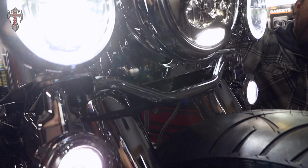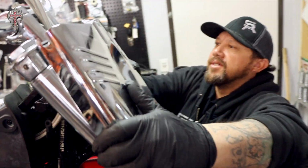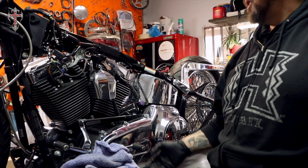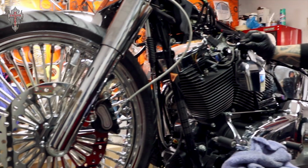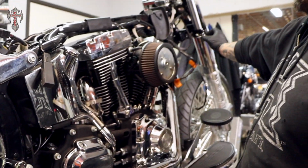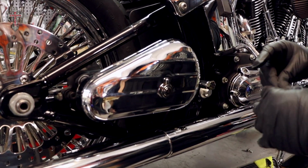Halos on the spotlights. Yeah, so it was a Fat Boy, so it's going back full air ride, front and rear, with the fast up. The rear is Legends, which is all self-contained, and the front is from Scully's Customs. 20 seconds and you ride it. And then the front has got these American suspension pucks that go inside here in the tubes, the fork tubes.